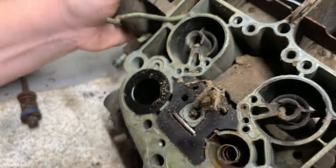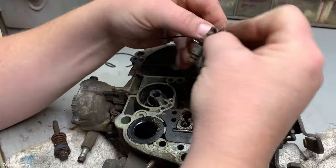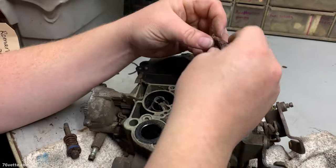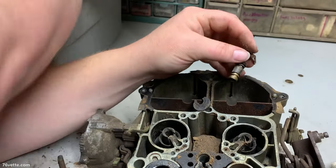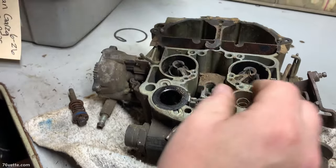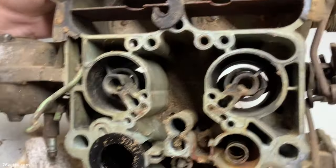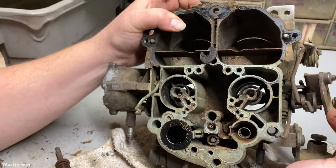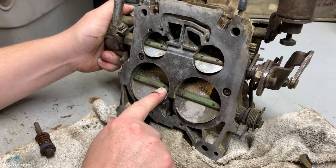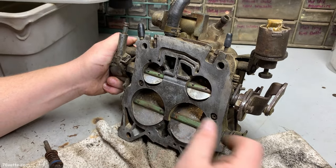This is all stuff that's going to get fixed with just a few little processes. That may look really bad now, but all of these little pieces — we're going to take them apart and clean them all with specific processes. Brass and everything will get treated differently. These little springs — we take care not to lose that little stuff. Plastic and all of that will get treated separately as well. And even though the inside of the carburetor looks like that, it'll still look brand new when we're finished. We'll keep tearing it down all the way through the base. I'll take a Dremel and get these guys out — these have all been stamped in, it's a swage. I'll knock that swage off with the Dremel and then pull both shafts out; they'll both be bushed.